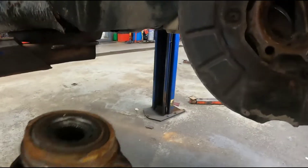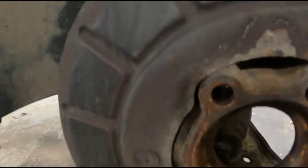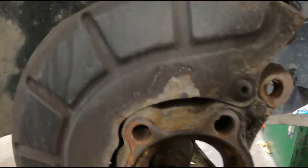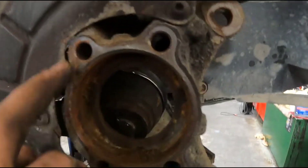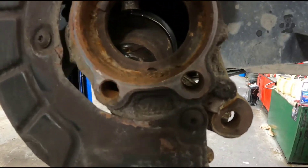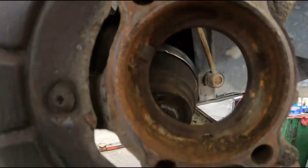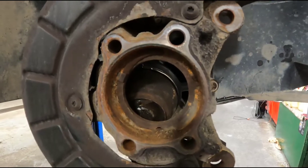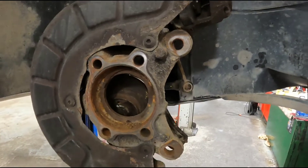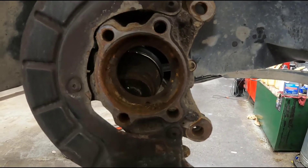So that's why I'm replacing this — this wheel bearing sounded fine, there was no real problem other than that. Next step you want to do is just clean this real well. It doesn't have to be spotless, but you want to make sure that minimally the flat surface in the front is pretty clean. Just use a scraper, a wire wheel if that's what you have. The inside bore here, just scrape it the best you can — you can scrape it with a flat blade screwdriver — just something so the new one goes in nicely. Brush some grease or anti-seize on it and then you can put the new one in. The new one should come with new bolts — the bolts have Loctite built onto them — and then just reverse procedure from there.